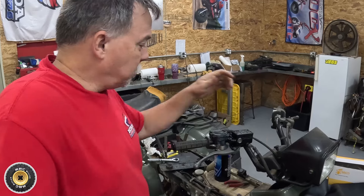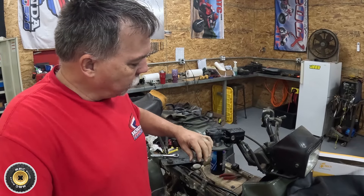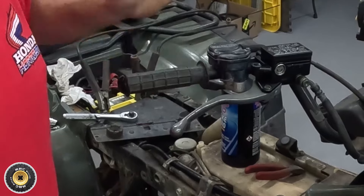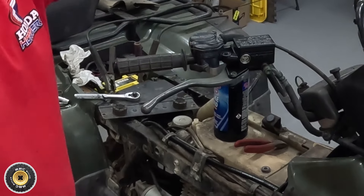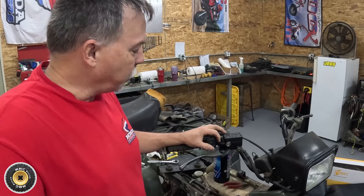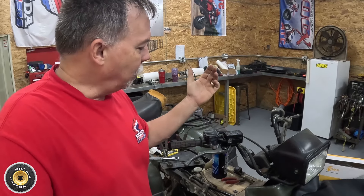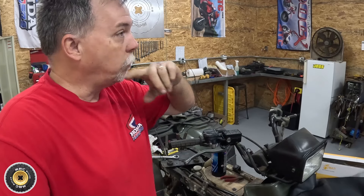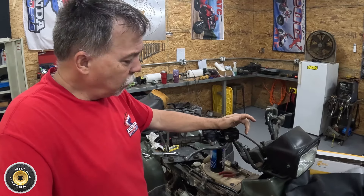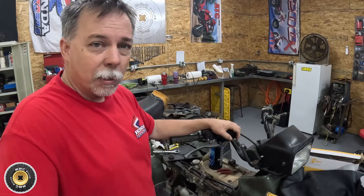Just like that, master cylinder's replaced. This is a 9 out of 10 copy - it's not Honda but it will certainly work. The factory lever was a tad thick for the opening so I took about ten-thousandths off and it slid right in - no binding. It matches the original handle. Once everything's cleaned up it's going to look really good. The real tell is the rearview mirror mount, but it works and it's cheap. If you're interested in a master cylinder, they make different styles. The big takeaway on these: make sure your output or discharge is in the same location as your original - whether on the inside or the front, match that up and everything should go smooth.